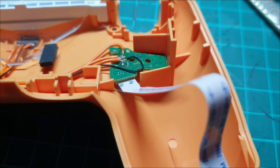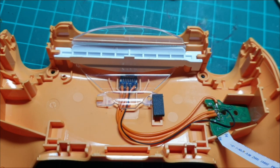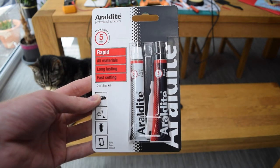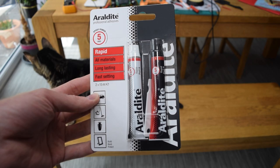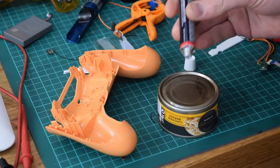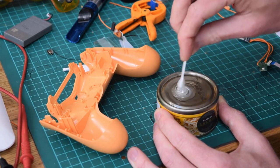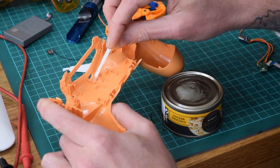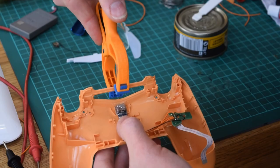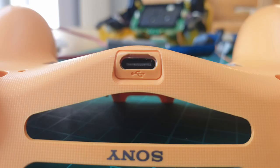Next it's time to get sticky. There is a lot of space between the new board and the controller case so super glue is not going to work. If we don't make a really good connection between the new USB-C connector and the case it'll just fall off and it'll be a regrettable mod. Enter Araldite two-part epoxy resin. This stuff has excellent gap filling properties and it dries hard as rock. Adhesives like to have rough surfaces to grab onto so I've roughed up the inside of the case and the USB-C connector with my files. The way Araldite works is that you have the resin and a separate compound which hardens it when they're mixed together. You get about five minutes to move things around and get it all in place, then you hold it in place with something and leave it for a couple of hours. Here I'm going to generously slop this stuff in place and then place the connector down on top of it, then carefully move it around until it's in exactly the right spot. Next I can take my clamp and hold it in place to dry. Once it's dry it really is hard as rock and I think there's no chance of it becoming detached. Hooray for Araldite!